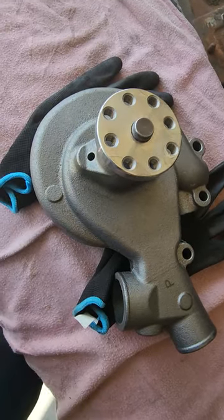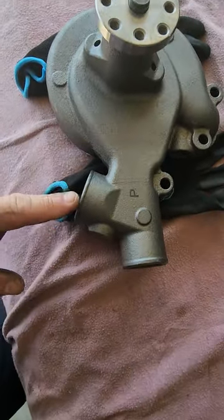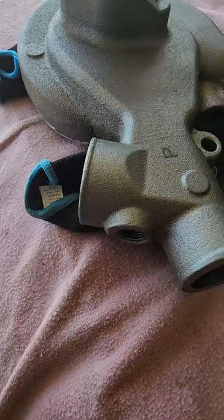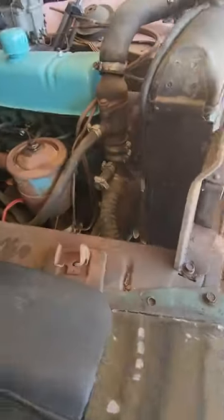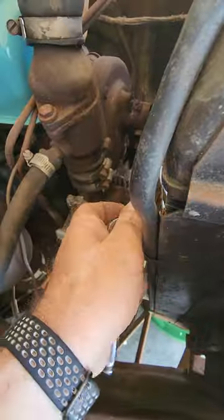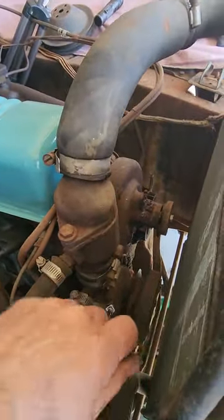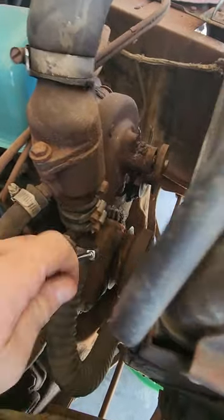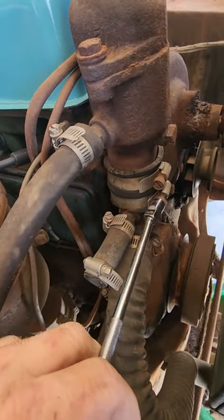Always a good idea to take a look at your new parts so you can see where the bolt holes are: one, two, three. And of course you have your hoses and possibly something in there. We're going to disconnect the hoses — it's also a good time to do the thermostat. Now we're going to loosen the hose clamps, which are all SAE if they are original clamps, which in this case actually looks like they might be. Amazing how they've stood the test of time. Use a 3/8 socket, or you can use a flathead screwdriver, but I'd recommend using the socket — certainly a lot easier. Disconnect it and make sure you get them all.